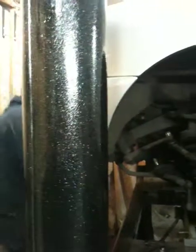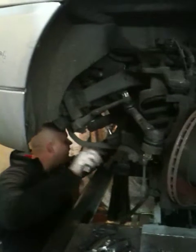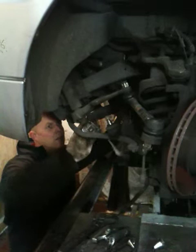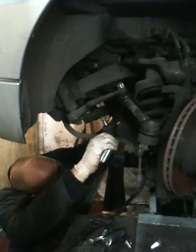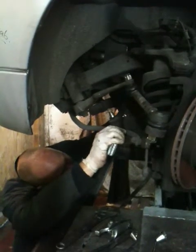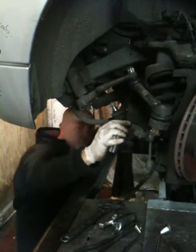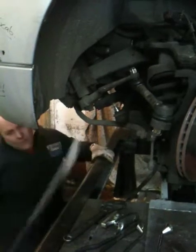Wicked, that is. Right, measure. Let's see what it is. I'll throw that through first. 32 3/8. Double check. That's complete balls. 32 1/4 even. So when you go down to the tracking place, you won't scrub your tyres out, because it'll be roughly right.